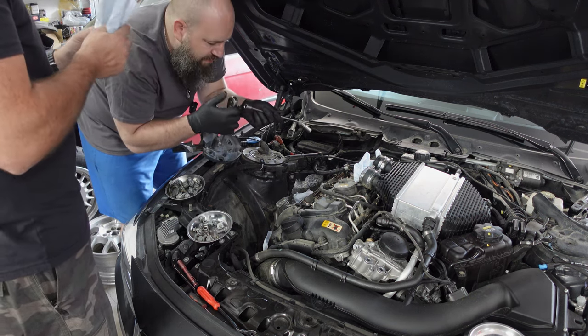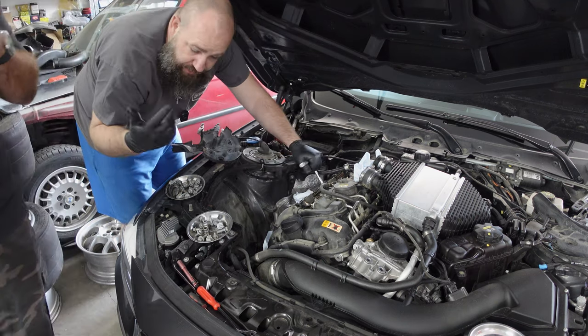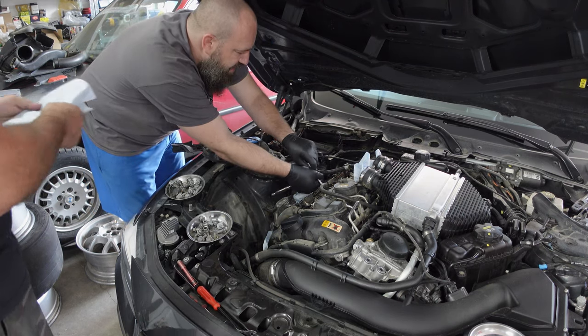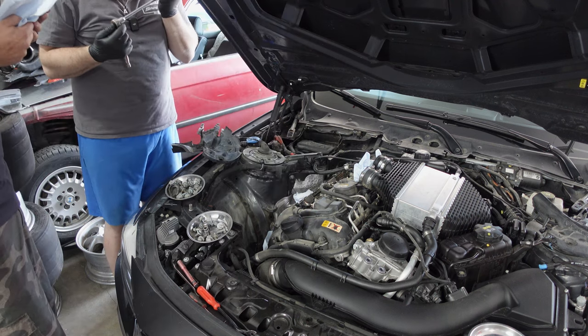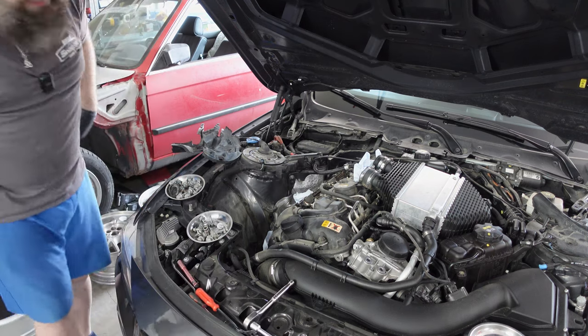There's oil on top of one plug, and cylinder 6 was loose — could you imagine misfires from it literally blowing compression out of cylinder 6 just from being loose? Something is definitely wrong with these plugs — something ain't right.